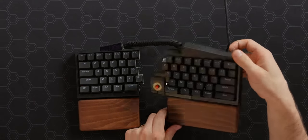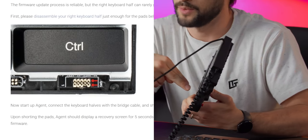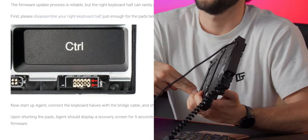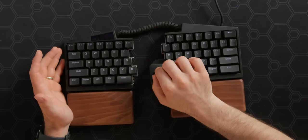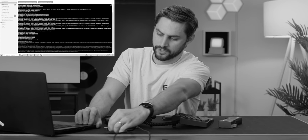Update — all is well. We got it fixed by holding the wires across those two jumpers for longer, throughout the duration of the firmware flashing. The other issue — clicks not working even though they were mapped in software — was fixed by remapping to something else and then back to clicks, and then they worked as intended. So it's all good. User error: don't unplug it before it's done flashing the firmware.